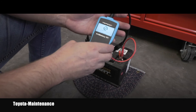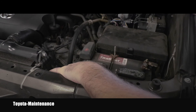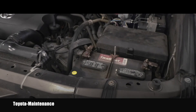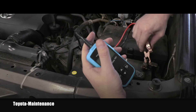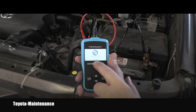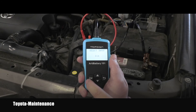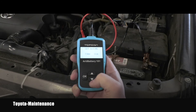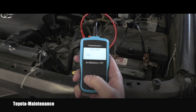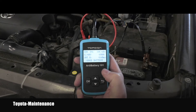I have right here a 2012 Toyota Tundra, so let's do the in-vehicle battery test. This battery has a sticker showing it was made in August 2016, so it's way newer. I dropped this vehicle here today so it should be fully charged. From the beginning I can see it has 12.4 volts. I'll push OK, select 'in vehicle,' select the charge type as regular, and enter the CCA - this one has 710 CCA.